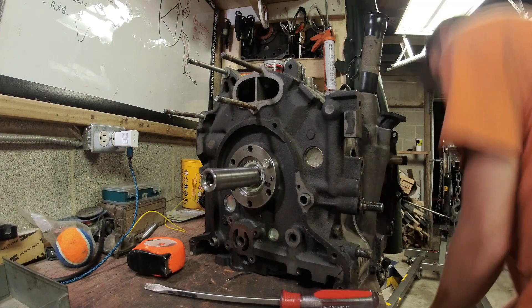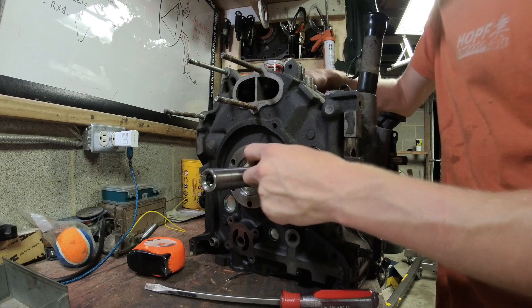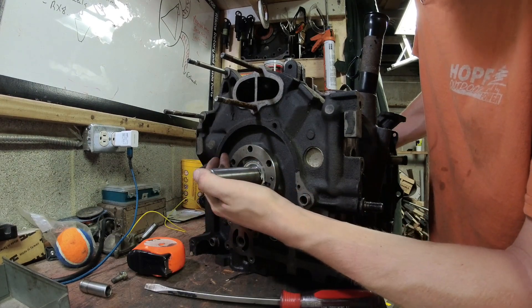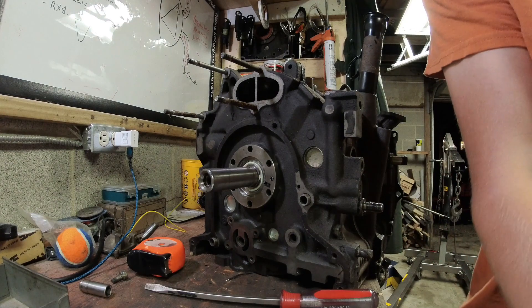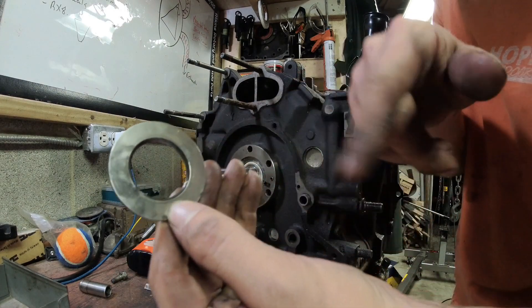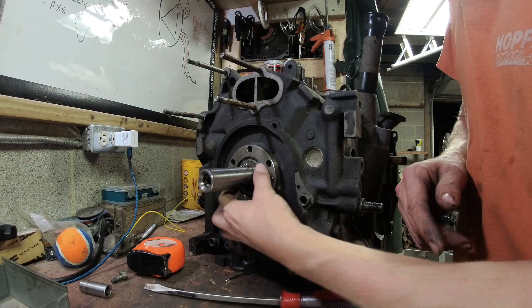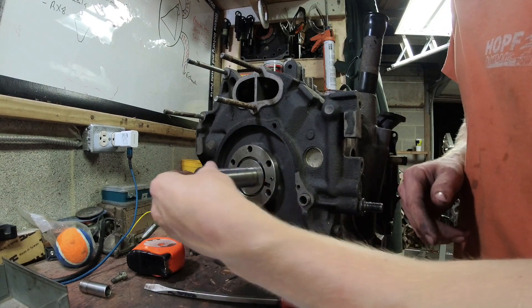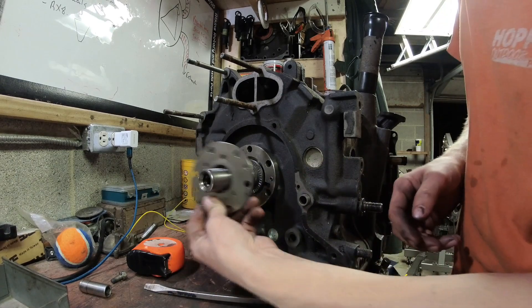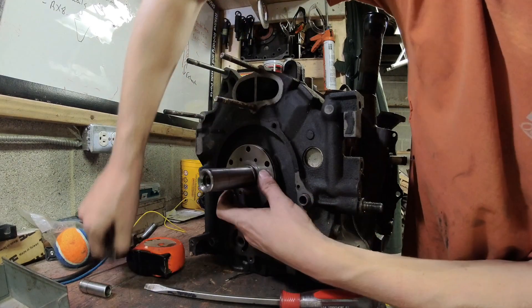This block isn't completely bolted together — it's got two tension bolts in it, just chilling. You can see the end play right now. Taking the parts off: the little chamfered beveled edge of this washer needs to fit on the beveled edge of your eccentric shaft, so put that down. Then put the spacer on, and the Torrington bearing goes on over the spacer.